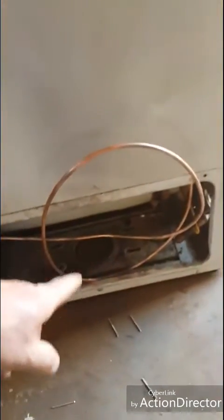So I'm going to go ahead and put in the compressor, weld the pipes up and do the capillary. So I've got the compressor in, as you can see. The welds are done. The capillary tube — I put it in, I fed it in just through a piece of copper pipe. From the inside, there it's welded into the coil.